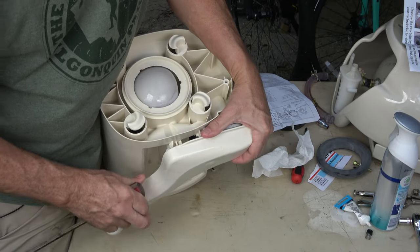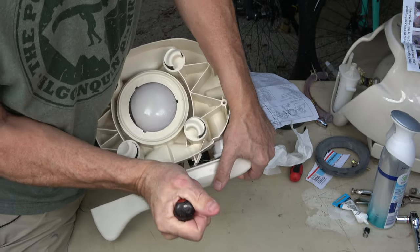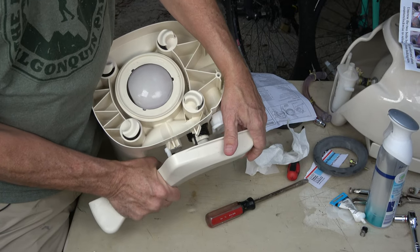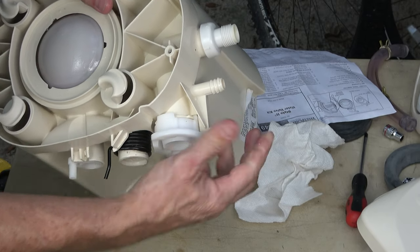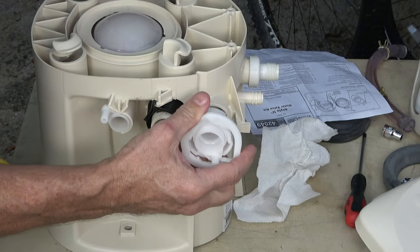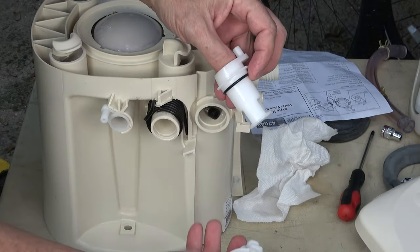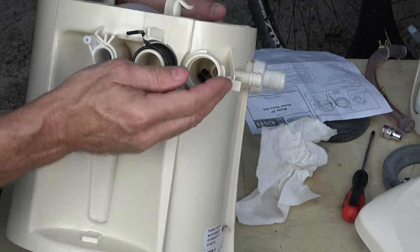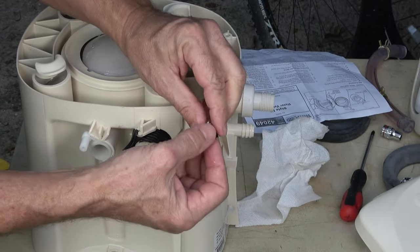Remove the pedal by holding the base from the front underside of the pedal and pulling the pedal up and off with a quick motion. I had to use a screwdriver to apply some leverage to push the pedal off. Pull up on the tab on the water valve cartridge retainer and rotate the retainer clockwise until it hits the spring. Grasp the retainer and pull the entire water valve assembly out. Pay attention to how this comes off so you will know how it goes back together. Remove the water inlet seal compression spring from the opening where the water valve cartridge came out — you may need needle nose pliers or a screwdriver.